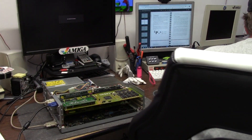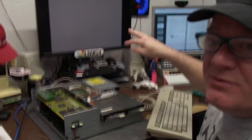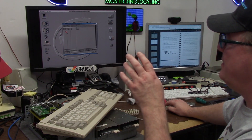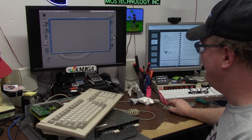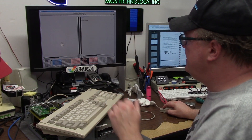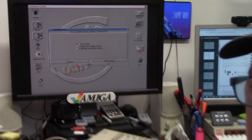I must have bumped the power button. Let me get my keyboard — I'm just going to hang this off to the side. Hit the button, let's see what happens. So as you can see the pass-through is functional. We're going to launch SMB Mounter. I am running the Roadshow stack, so it's mounted automatically and then I can get to my network stuff. Mainly I need drivers. I'm going to use Directory Opus to get to my Amiga share. And then Apps, and then P. I bought the latest Picasso 96. Welcome to P96 — 2020 Individual Computers. Now, this is just a standard Picasso install. We are a Picasso 2 — it automatically detected it. Wonderful. It's a very simple install.